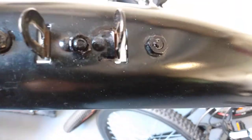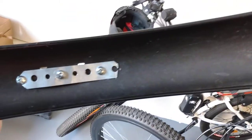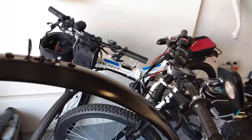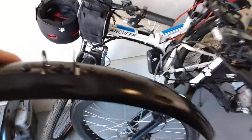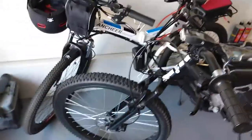This fender right here is off my Schwinn. And what I did with this one is, you can see the little tiny rivets. Well, they started to come loose. So I took some plumber's tape, drilled some holes, put three little bolts and nuts and red Loctited them. Now I'll put this back on my 27.5 Schwinn, and if it gets loose, I'll take it off. But you gotta make sure your stuff is secured. You can't just have some wobbly metal fenders on there, because if it does come loose, it's gonna cause you to crash. But anyway,